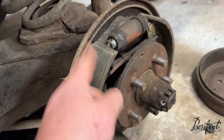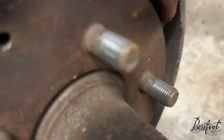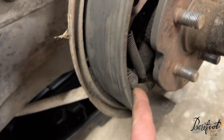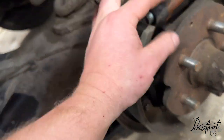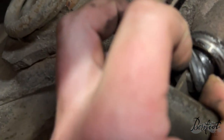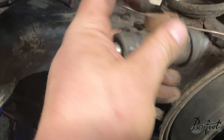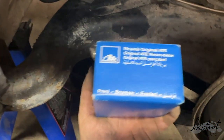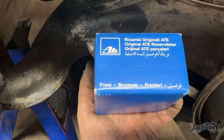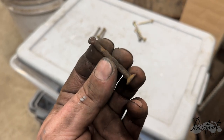Taking some rear brakes apart - shoes look new, but look at this: these have hex nuts on them. This should be a spring clip, but there's a bolt all the way through with a nut on the back side. These have some moisture in the boot, so that means this cylinder is no good. The bleeder was broken off too, which would have made bleeding these a nightmare. Luckily our friends at GoWesty have these ATE ones - these have always been good to me.